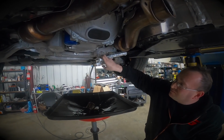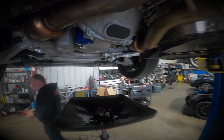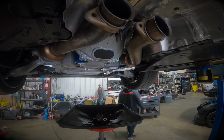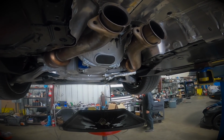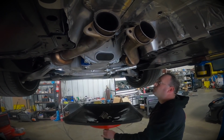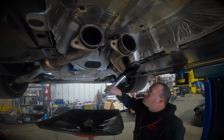How many miles on this one? Like 2,000? I think it's 2,000 miles on it. Yes, definitely drained the fuel out. The first pull I made, detonated its ass off. Second pull I made, detonated its ass off. And then I stopped. It only made like 607 and 608 baseline in it. So yeah, when you're done, definitely drain the fuel. Or have someone drive it home before I put it on the dyno and tune it. Otherwise, definitely drain the fuel and put 93 in it.